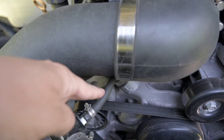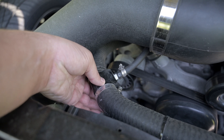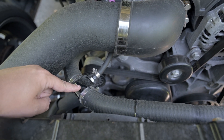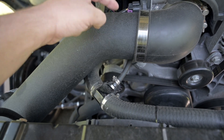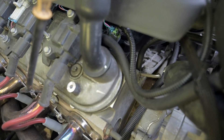It's running right back to the head — it's a really short hose that runs right under the air intake. You install the Mishimoto coupler in the upper radiator hose. You can see this is our upper radiator hose. You install that Mishimoto coupler, get the Russell barb fitting, get the hose, and basically just attach it right back there to the steam vent port on the head.